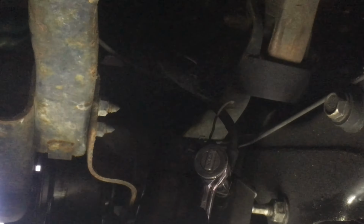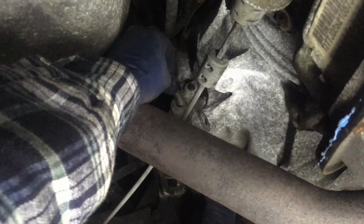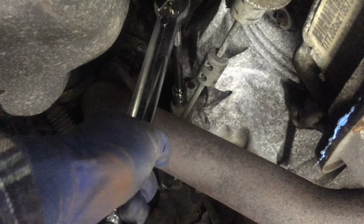As you've seen me doing, put the connector on the terminal and secure it with the 13mm nut. Plug in the wiring clip and press down on the red tab. Line up the starter and put the top bolt in, only tightening it by hand at first. Then put in the bottom bolt and tighten it by hand as well. Then torque both bolts to 30 foot-pounds.